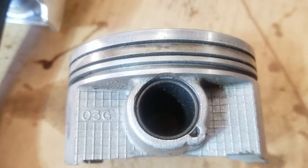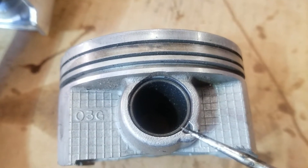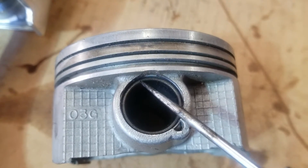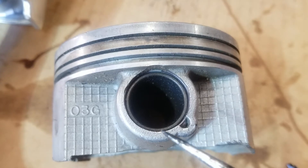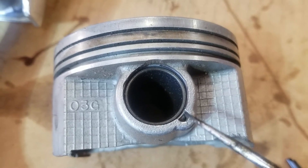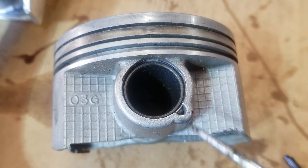Here's a different kind of piston right here. You can see it's got this spot to help you get a pick in there to pop it out. What I typically do is get one edge started right there, then pop the other one in, stick a pick in here, and rotate it around — and this one's at 12. You're never supposed to leave the opening right here at the edge; that's a bad idea because then the edge can get stuck in there, it could pop out, or it might not seat fully. Same deal up here, down here — not right here.